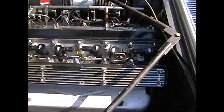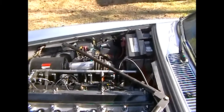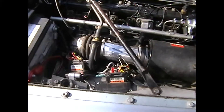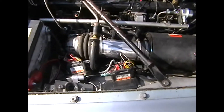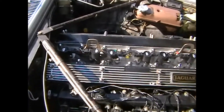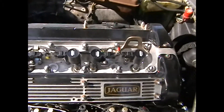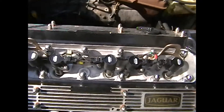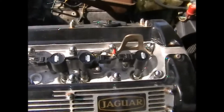One of the modifications is coil-on-plug ignition. They're powered by a pair of EDIS ignition modules from Ford. Each of these modules controls three cylinders — I couldn't make it work with a single module, but it works great with a pair of them. So effectively I have two three-cylinder engines as far as the ignition is concerned. The coils are from a 2000 S-type Jaguar. I chose them because of the way they mount — the little mounting point works well with the type of stands that I built.